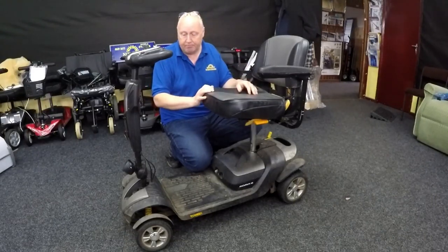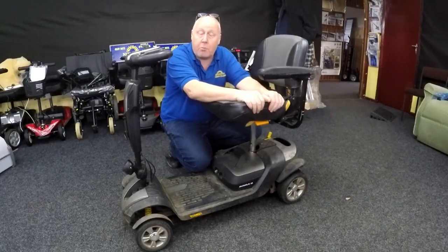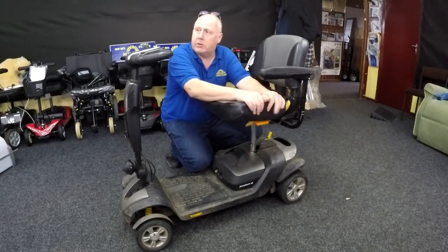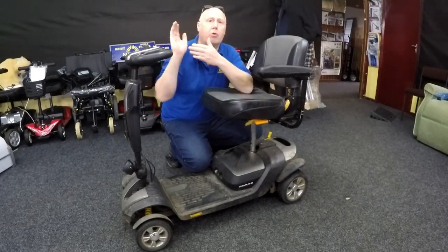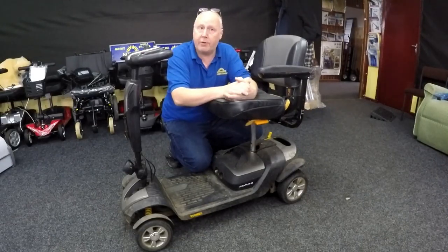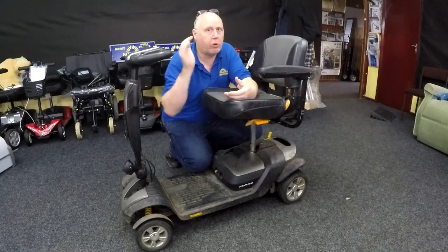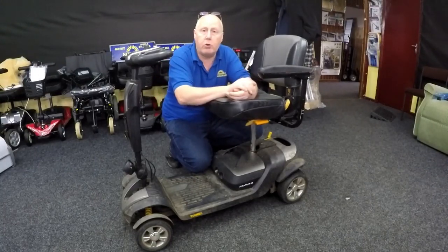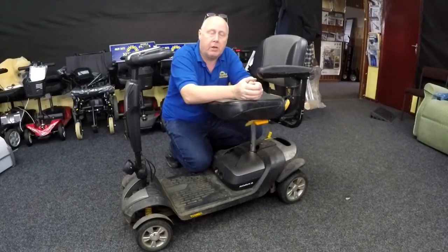This foldable scooter has given the customer a lot of headache. It's constantly cutting out when going over a bump. I'm actually repairing this on behalf of another dealership that was very busy and couldn't repair it. I drove the scooter a couple of days ago and it was nothing but cutting out. The voltage goes right down, the light on the display drops as if the electric brake is binding on, but the electric brake isn't binding — I've had it on the rolling road and the brakes aren't overheating.